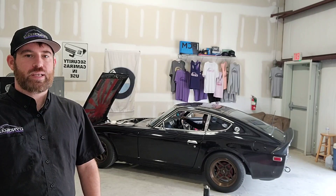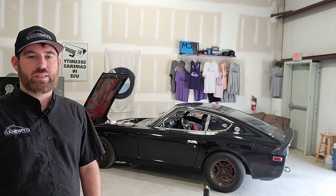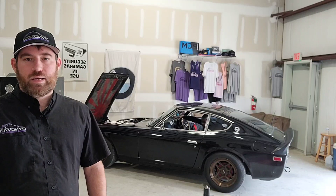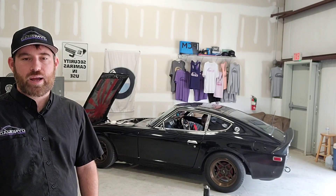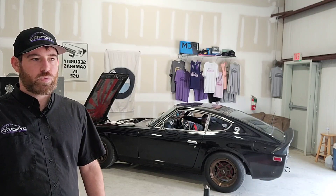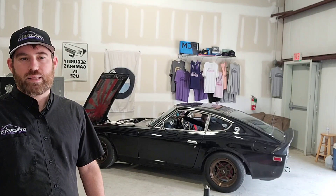We got something pretty special in the shop today. Sean's 240Z with an L28 and a pretty basic T3/T4 turbo setup. It's on MS2 MegaSquirt. We are having a couple of problems with some grounding issues — it's shutting off around 3,000 RPM according to the customer — so we're going to change a couple of grounds around and freshen up the tune a little bit, see what we can make with this new manifold setup. Went to a Godzilla Raceworks manifold and switched to three-inch exhaust, and we're hoping to get a little better spool and maybe make a little more power.